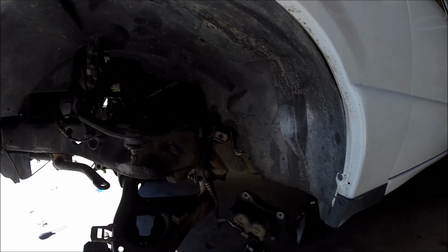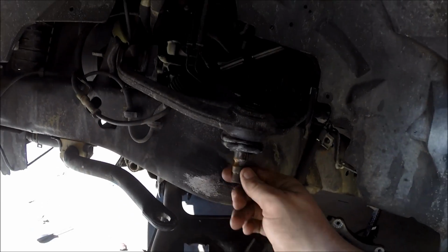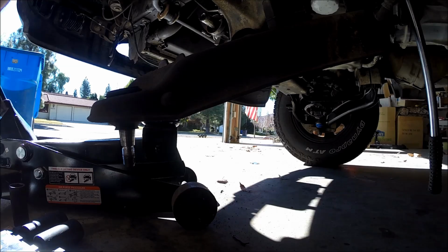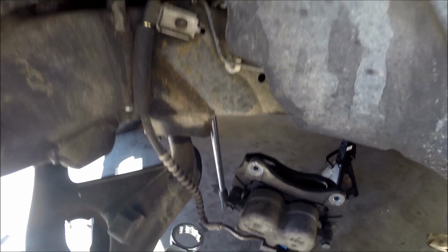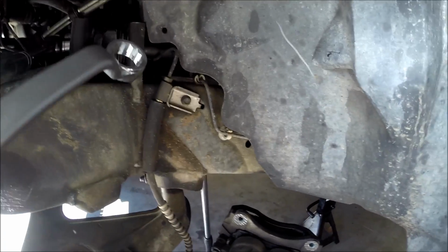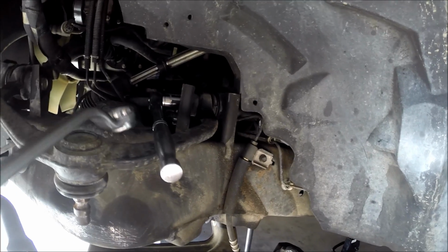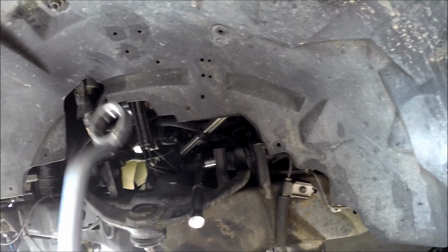Alright, we're back, and got some more juice in the camera. So we're going to take care of the upper control arm, the A arm up here, and get it out really quick. The setup I have going here is a little bit trickier. I got my breaker bar fished up through the other side of the frame with a universal joint and a 21 millimeter deep impact socket back there, and then there's a 21 millimeter shorty here with my 1/2 inch extension and my cheater bar to break it.